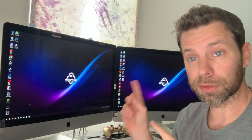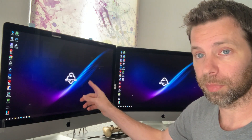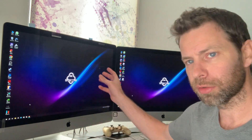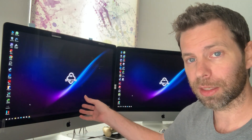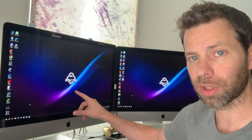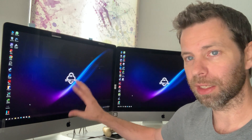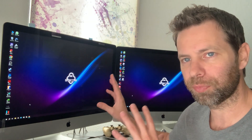I finally got Ghost Spectre installed on this thing. It was a bit of a process — a lot of headaches — and I learned a lot about the 2013 iMac. The two systems are definitely not alike. This one has an internal hard drive and a PCIe, and that does some funky things with the OS installation. Ghost Spectre overwrites the EFI, so I can't boot directly back into macOS. However, I do have an OS on the PCIe which still has OpenCore installed on it. When I go to install OpenCore on the solid state drive, it won't overwrite the EFI to allow dual booting, but I can still boot through the other OS — it's just a bit of a headache and a workaround. But for now the system works and all the hardware is functioning properly.